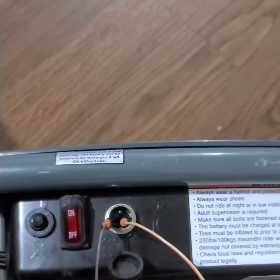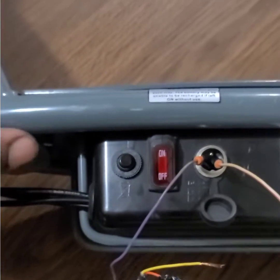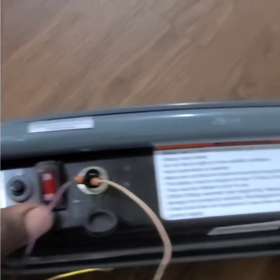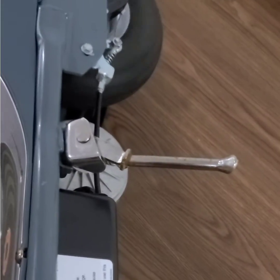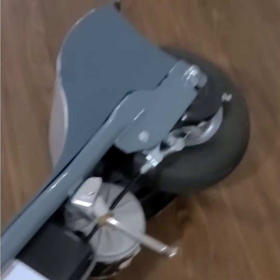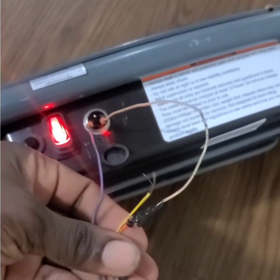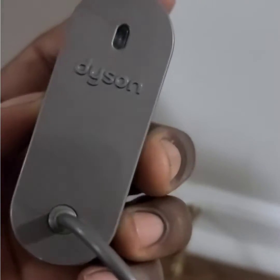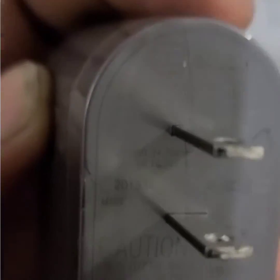That top pin is a dummy pin, so I don't use that one. So that's your charger for the electric scooter — it's charging, you can see it's lit up. I'll turn it on and show you guys that it's working. That's how you charge your electric scooter if you just have a regular 24 volt adapter. This is not a scooter adapter, this is just a regular 24 volt adapter.